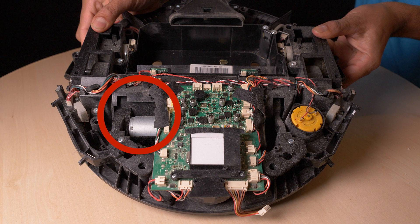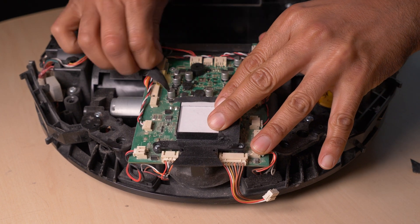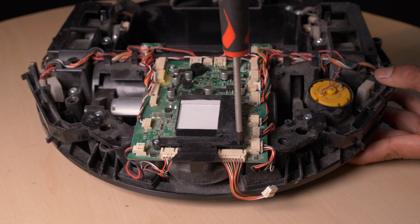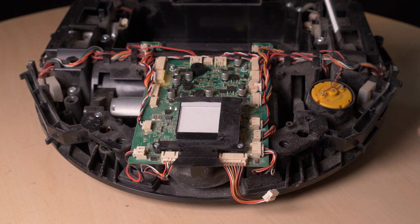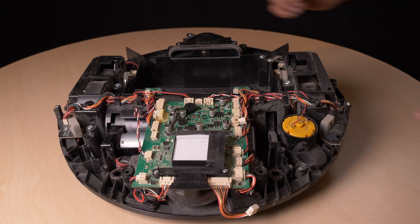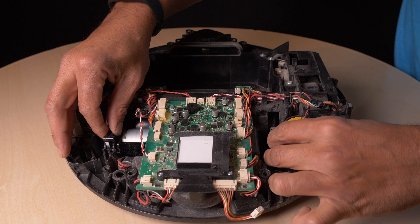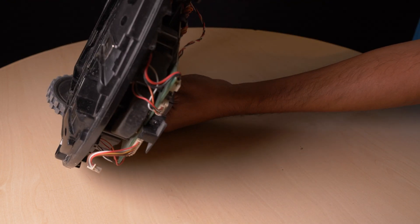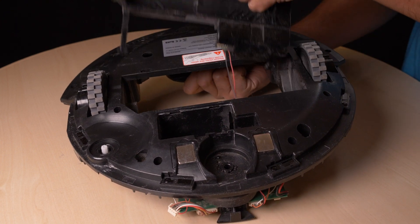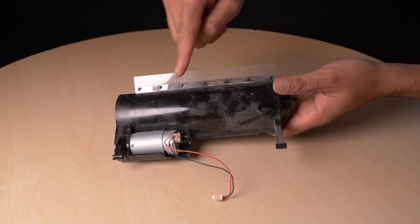This is the location of the motor and gearbox of the main brush. To get the motor and gearbox out, a number of steps are needed first: get some tape loose, loosen four screws, and take out two sensor arms. Next, pull the correct motor connector from the brain, move it under the electronics plate, and finally you can wiggle out the main brush motor and gearbox. This part should contain the cause of the 4 beeps error — the reason why the main brush does not turn.